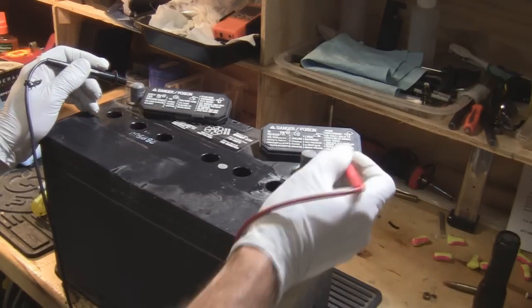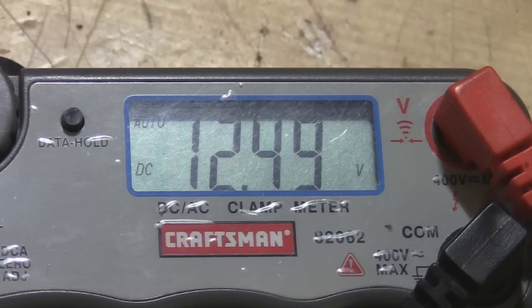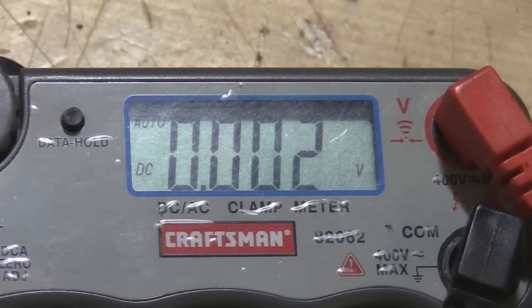Now I'm just going to measure the battery voltage. We're getting 12.50 volts. We know 12.6 would be a fully charged battery, so we're 0.1 of a volt off. That bad cell is showing around 2.0 volts instead of 2.1, which drops us to 12.5 instead of 12.6. Even though I got home and the car started, if I keep that battery, after a couple more starts it's probably going to break down on me — maybe strand me in the desert. So that battery is getting replaced. Thanks for watching.